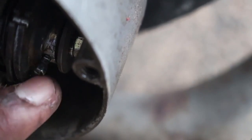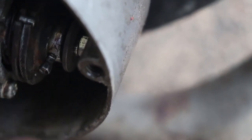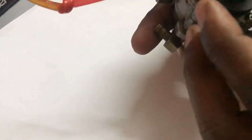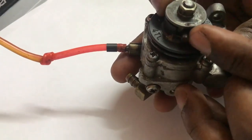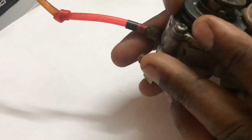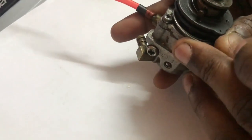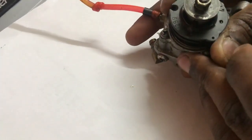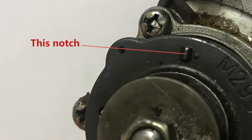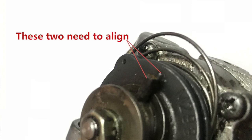The autolube or the 2T oil pump is not a completely useless thing, but if you ask me, it is a pretty dangerous thing to rely on. It is dangerous because it can fail at any moment without any notice. What actually happens is when the oil pump fails, the crank is normally lubricated by 2T oil, and when there is no lubrication the engine will seize — metal meets metal, friction is not metal's friend, and with a lot of heat everything just gets friction-welded and seized.